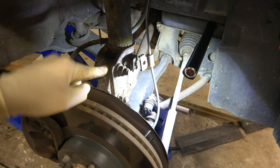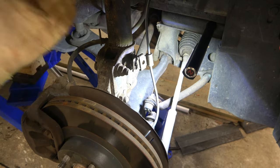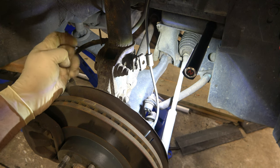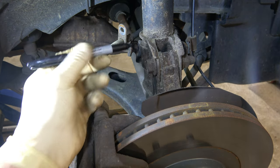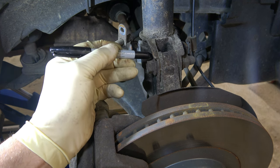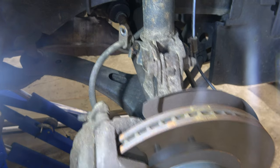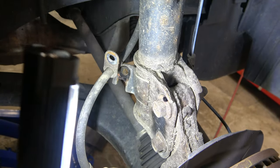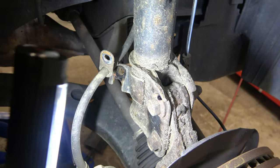Next, we're going to be removing these two bolts. However, this top one is an eccentric cam bolt. I'll move the camera over and show you — I'm going to mark this with a magic marker. They recommend, and I would recommend, doing an alignment after you take these bolts out, but it's not necessary as long as you make your marks. Supposedly it should all line back up. That bolt right there is your eccentric bolt. I'm going to mark a line here at the top — that's just going to give me a rough camber adjustment.